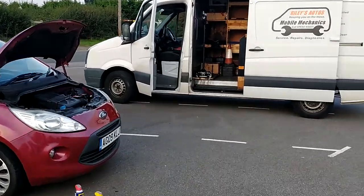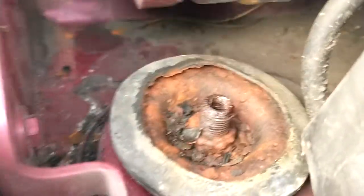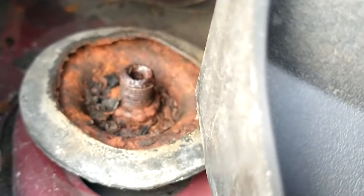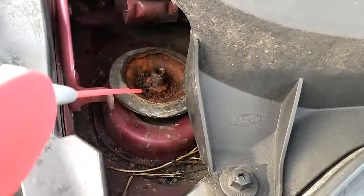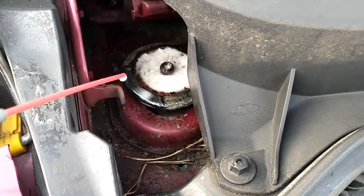I'm going to show you a couple of tricks on this car that can save you some money. If you look here on the top suspension struts, there's a lot of rust. When it comes to doing any repair work on this, they may not get that bolt open, which will cause a lot of problems. Get some WD-40 and spray a nice bit on there so it fills up.